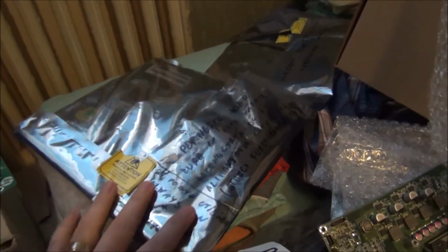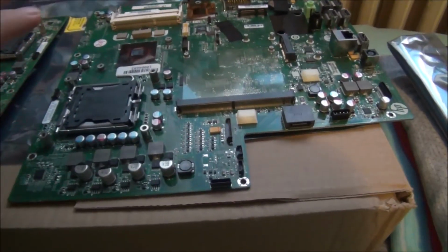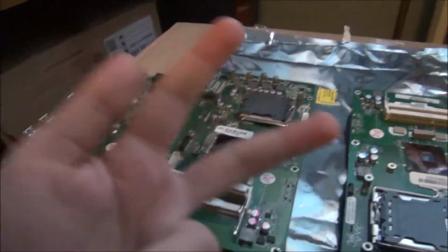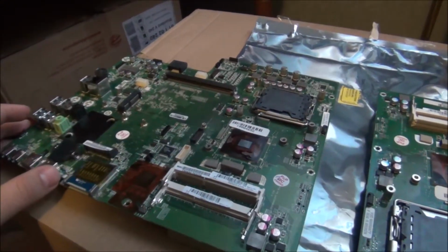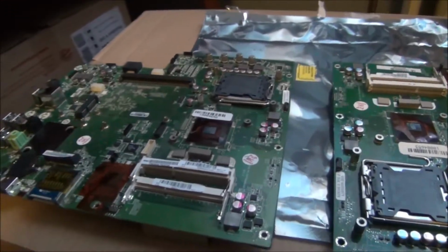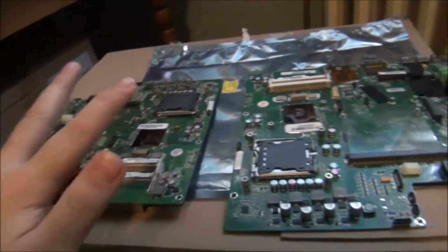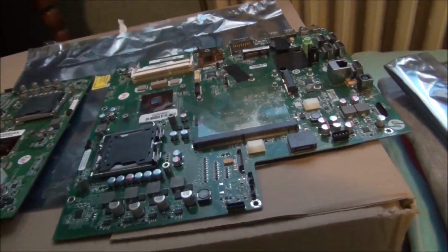Well, then I went and bought 3 of them. 2 of them came with these caps on and are working beautifully. Absolutely no problems. The third one is with the black caps and it's making a squeaking high-pitched noise. And at the first startup, because I tested all of them to make sure all three actually work, because I want to keep them as a backup, because they could fail again and I want to use this as much as I can. First time I powered it on, the light went off a few times in the display, which is powered from this motherboard. Actually not directly, it's getting powered through a wire here, then a driver, because this is LED backlit. So this is also bad. This is the third motherboard with black caps and low quality that is going to fail, and the other two are working perfectly. Is that a coincidence?